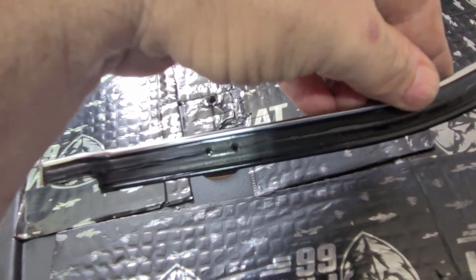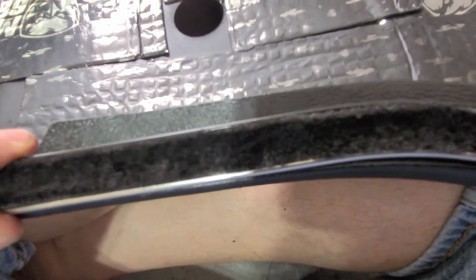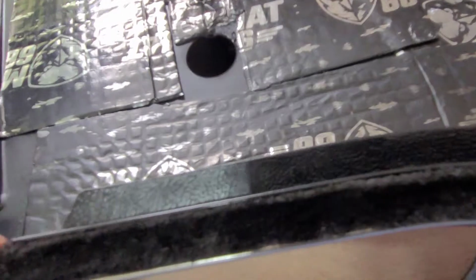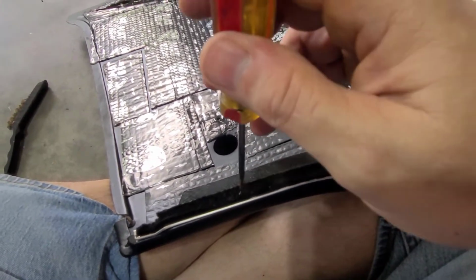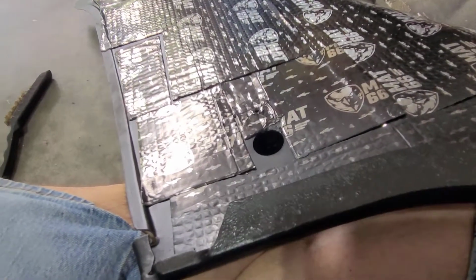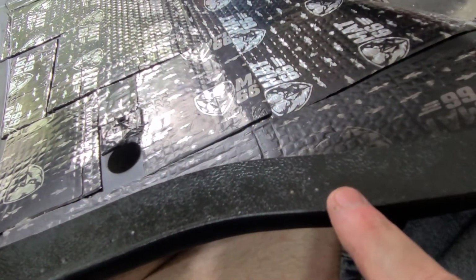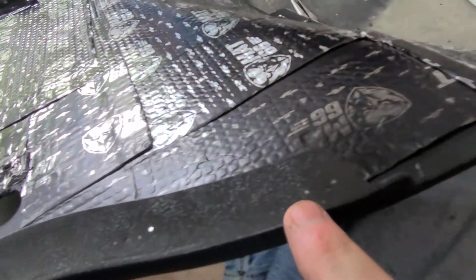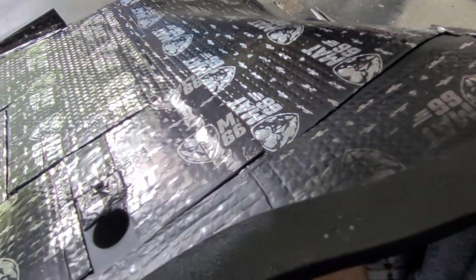Okay, now, as I suspected, the holes that are already punched on this for the staples don't match my original staple holes. So what I've been doing is laying this piece up, you know, where it needs to go, trying to do this one-handed and hold the camera, and then taking this and going through those holes and scribing where those new staple holes are going to be. So you can see this one actually came close, and then this one up here. So I'm going to go ahead and get that stuff marked up, okay?